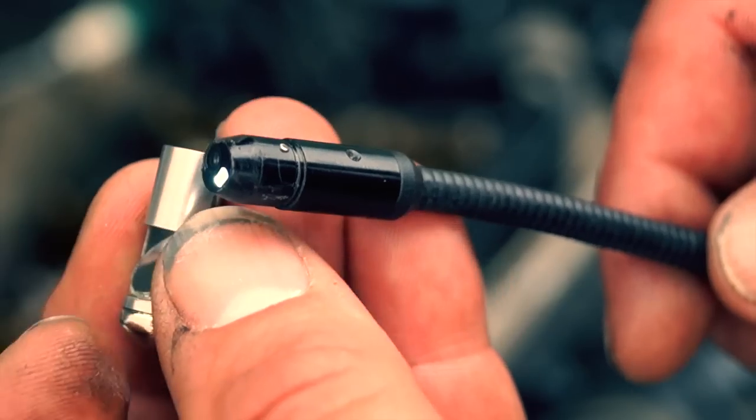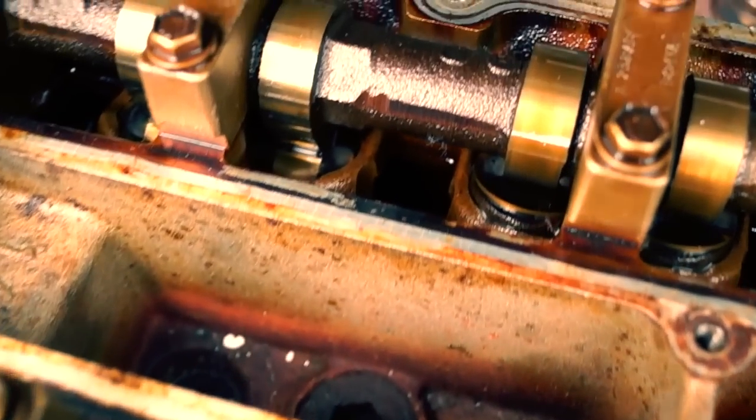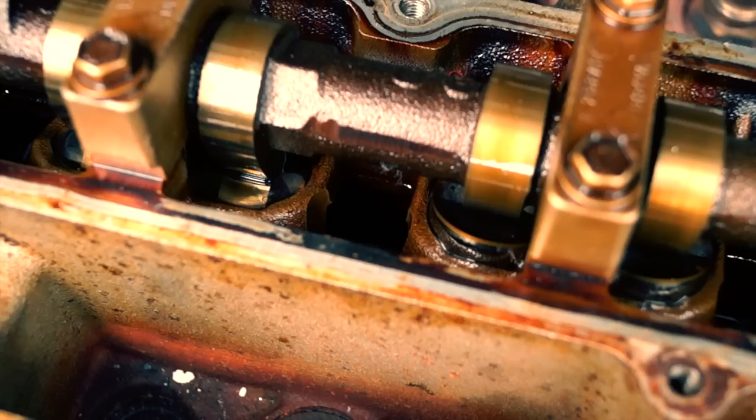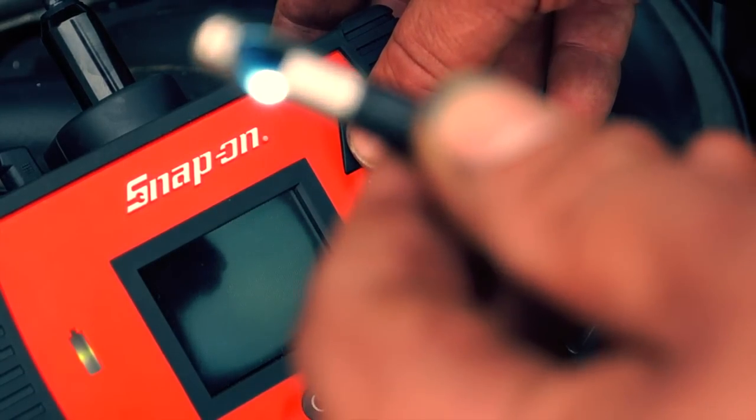On the end there's a camera with a lamp. I absolutely love the word 'intrusion'. What we're doing is looking down the spark plug hole onto the top of the piston, just looking for any sorts of damage or anything that looks unusual. The best type of endoscopic device is one that you get adapters for - this is a mirror so I can see up the top of the bore and you can see the valves very clearly. The valve I was actually looking at would be something like this - fully down with the camshaft pushing it down. This has a lamp as well.